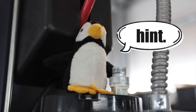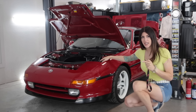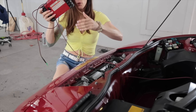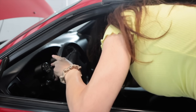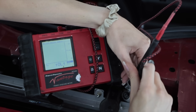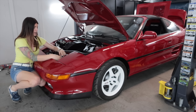I found out that these fans will not operate at half the voltage. The following day, I picked up a new relay from the auto parts store, so hopefully this thing will last at least two weeks until the genuine Toyota Denso one arrives in the mail. I don't think these brushless fans will operate in series off of just six volts. A simple math equation will tell me if they'll provide enough resistance to make that possible, but I think these have a minimum 10 volt requirement. I want to see what the resistance of this motor is. It's open because I'm measuring a circuit card, not an actual motor winding. I could just Google how this works and explain it like I'm some kind of expert, but I'm not going to pretend I know everything.